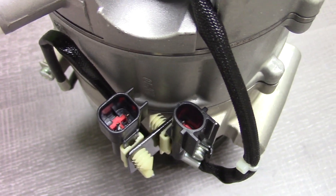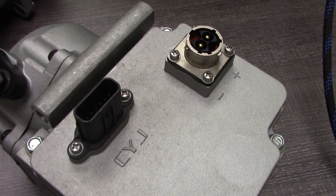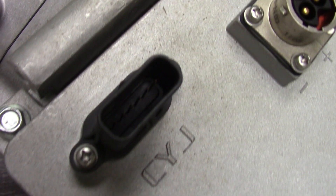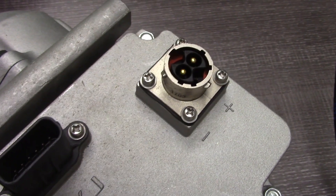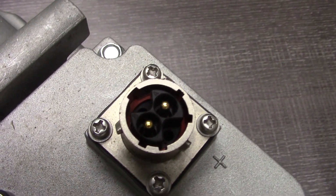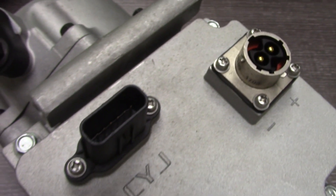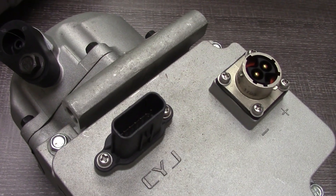On the extreme you have an all-electric compressor. These are required without a doubt to be the same. There's a lot of communication that goes on with your electric compressors and they must be the same in order for this to work. So try to see if your connector looks the same — sometimes this can be really difficult. Looking inside the electrical connections is often really difficult online because a lot of suppliers or manufacturers don't take those pictures in such good detail that you're able to really see it. Try to verify if there's an ECV — you can usually tell pretty quickly. If you can look inside your connector and the replacement, definitely do that; it would really help to make sure you get the correct compressor.